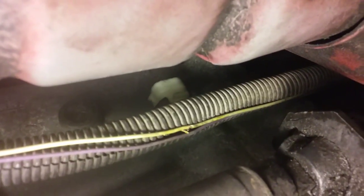so this can be plugged in right up here. I don't know if you can see that or not. Well, to be plugged back into the, there it is, right there, to be plugged into that harness, because obviously the 4-prong won't fit where the 5-prong used to go. Really the only purpose this serves is to let the computer know that the transmission is in 4th gear, at which point the torque converter locks.